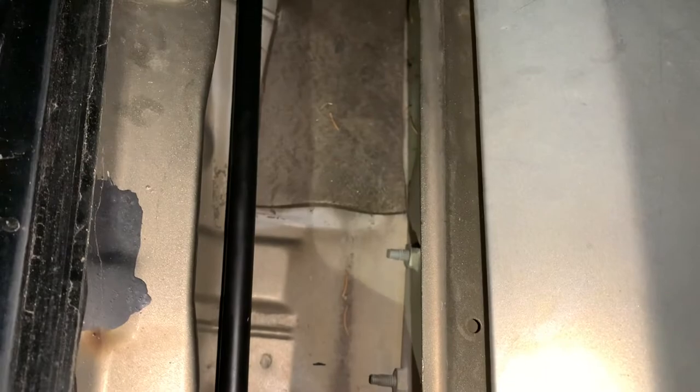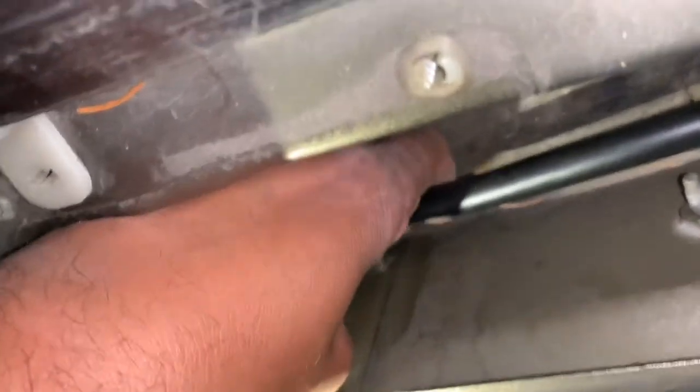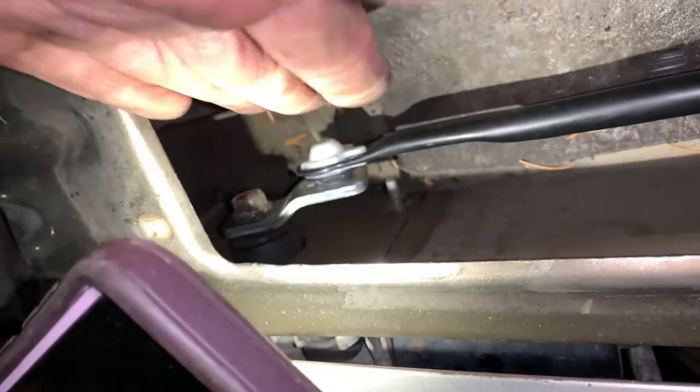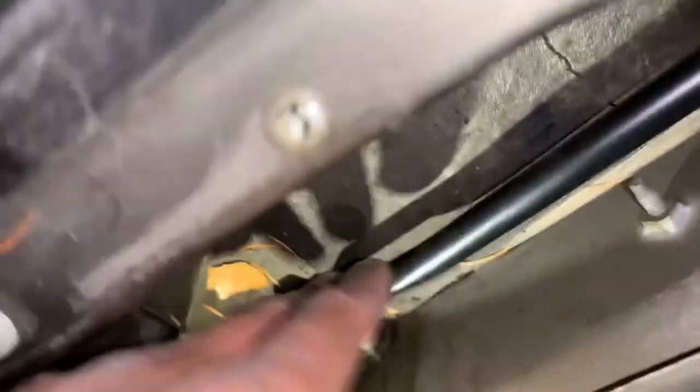Once it gets out, get your brand new transmission. Line up everything one by one — fold it from the driver's side end, slide it inside, and then when it gets to the middle you align it. You're going to need a 9/16 or 15mm to do this. To tighten it, I put my hand here and my wrench over there, doing opposite forces — my right hand tightening and my left hand holding it in place, because if you don't do that the whole thing is going to come up since it's supposed to move.